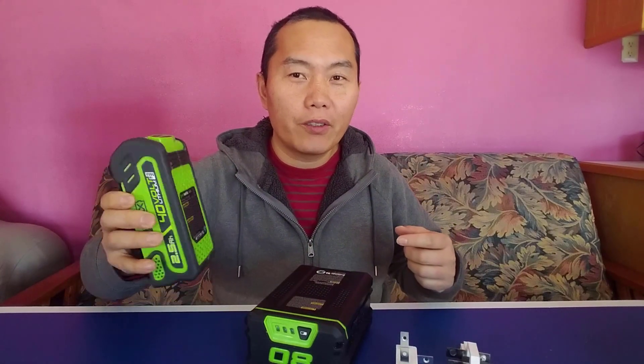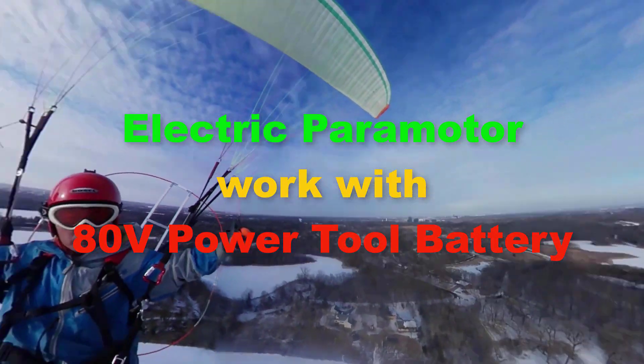Today I'm going to talk about the battery for your electric bicycle. The number one common problem for the electric bicycle is a battery dying. In Minnesota, we have winter like six months. If you don't ride a bicycle for that long and you leave the battery inside, it's more likely the battery will drain out and won't take any more charge. So the battery will die right away.